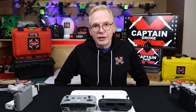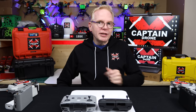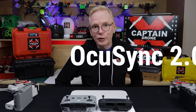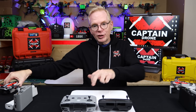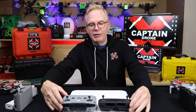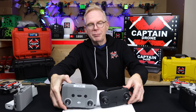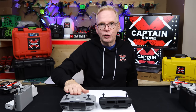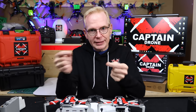One of the changes DJI made with the Mini 2 is they used the controller from the Mavic Air 2, and I love that controller — that shape and style is really awesome. By using the Mavic Air 2 controller, the Mini 2 gets OcuSync 2, which is what the Mavic Air 2 uses. Because that controller is larger, it has a much bigger battery inside, so you'll be able to fly longer with the Mini 2 controller than with the Mini 1 controller. The Mavic Mini 1 used enhanced Wi-Fi, which had pretty decent range. The Mini 2 uses OcuSync 2. The enhanced Wi-Fi had better latency — if something's coming at you while flying, the signal response back to you is slightly faster with enhanced Wi-Fi.